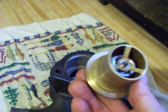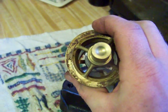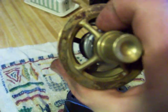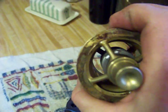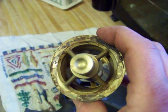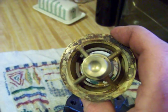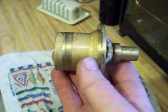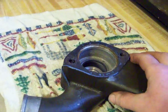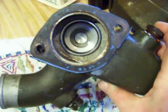So, if you put the heater in your water pump, you do in fact have a continuous circuit up above it. The heat will rise up through here — I know a lot of you don't like that word — it will go back through into the block, forcing the cold water down out of the oil cooler and back to the water pump. While I still hold that it is a less efficient way to heat the engine, rather than actually putting in the block heater freeze plug where it belongs in the block.